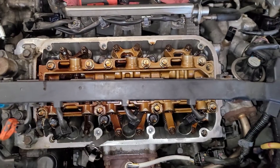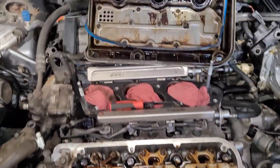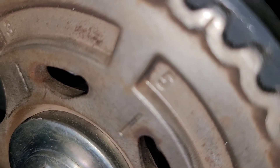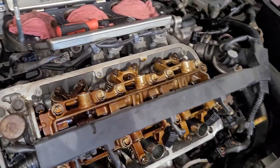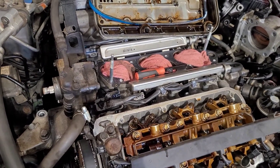I'm going to finish adjusting this side, fix the oil leak over here, put this side back together, and then run over to the back side and do that too. On the cam gear down here, see that number five right there? That number five lines up with the mark there, which means you can adjust cylinder five. This cam gear has one through six on it — that's how you know when you can adjust the valves. Let me keep it going and get this thing done.